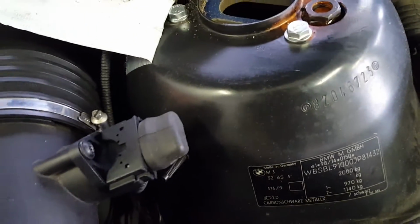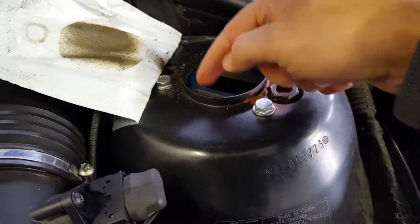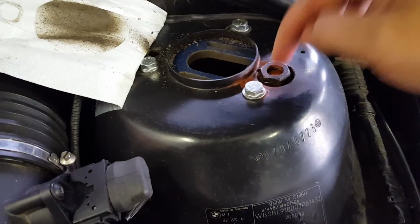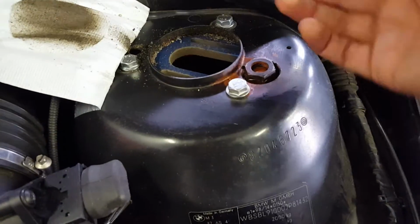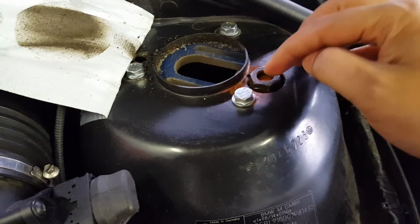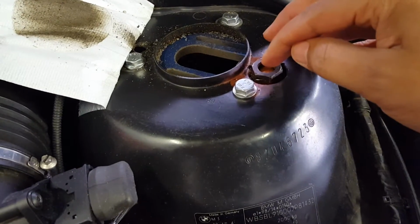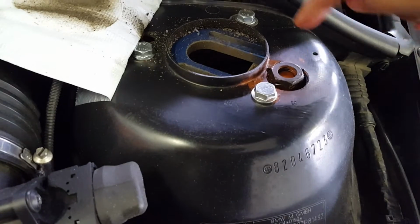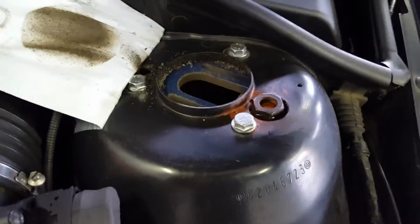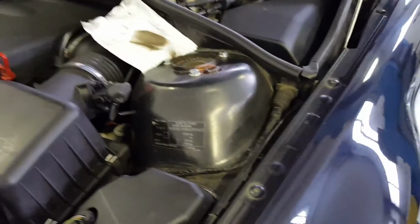It requires some skill and also a little bit of tinkering, because you hold this plate underneath to find where the point is. What we did was mark the plate underneath with a lot of grease, and then we held it up to the right position. We bolted it in, then we bolted it out. Then from underneath you could see exactly where the hole should be. Then we drilled a small hole through the tower so that you knew where the big hole should be, and then we made the big hole. That took a lot of time. A paper template on top, drill, finished. That would have been easy. But I guess some people just don't care.